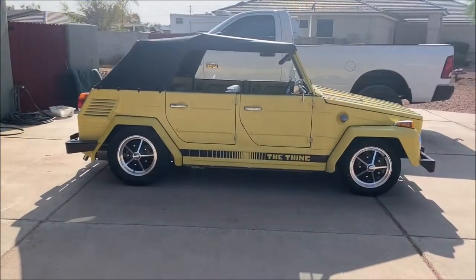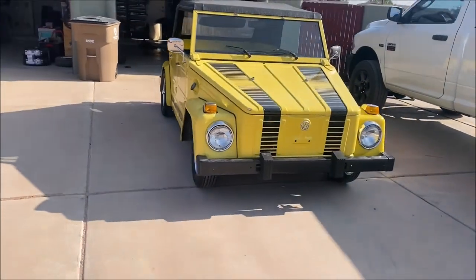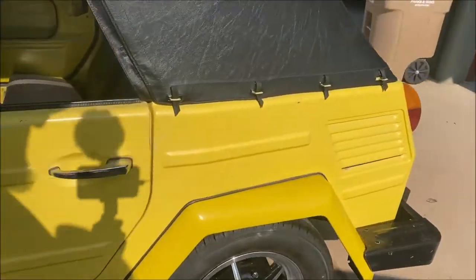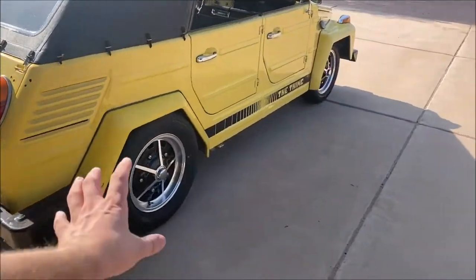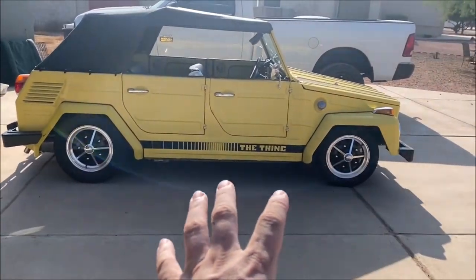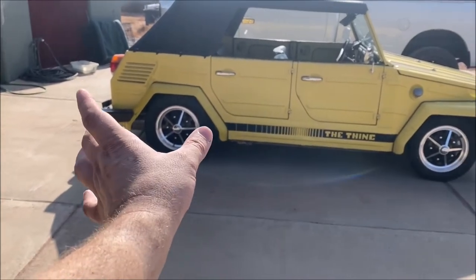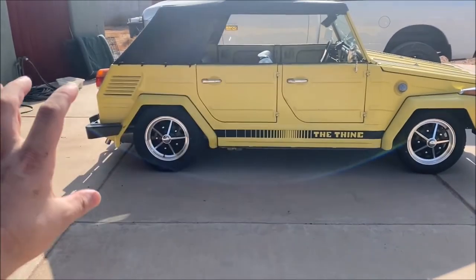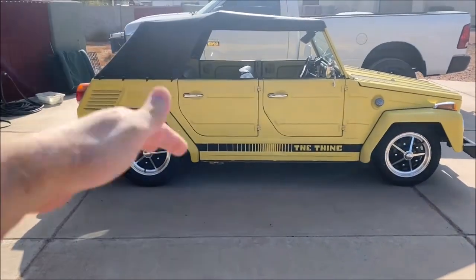Speedy is on the ground and we pushed her out of the garage right now because it's not fully back together, just to get a look at where we're sitting. Now, weirdly, the front is lower than the back, but the back kind of looks like it is lower than the front. And I don't know how much adjustability we're going to get out of each corner when we really start trying to dial it in. You can see the rear wheel is a little bit forward in the wheel well, so I think we need to utilize those slots and get that straightened out a little bit, because I can see the tire also is cocked in a little. I think the same on the other side.